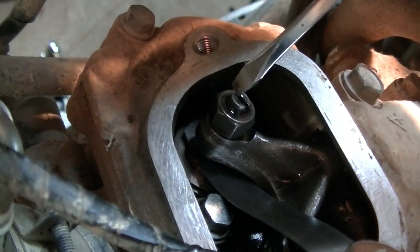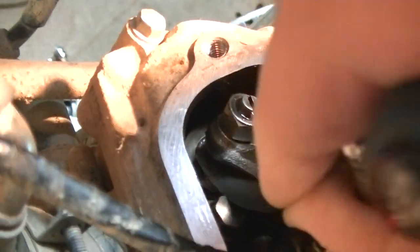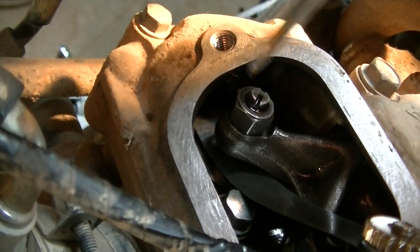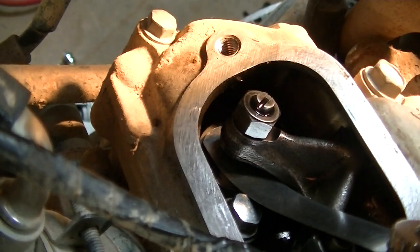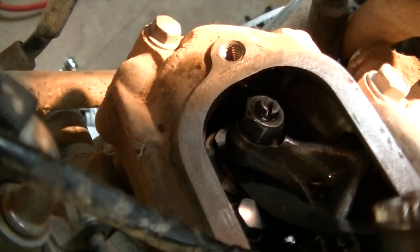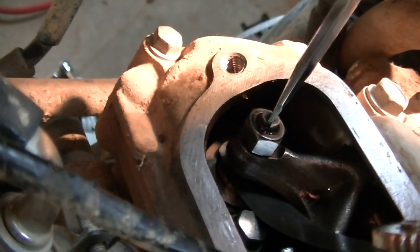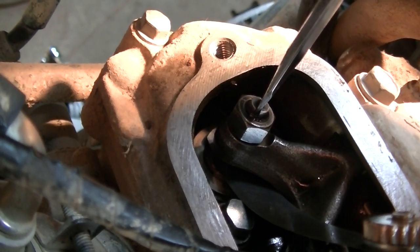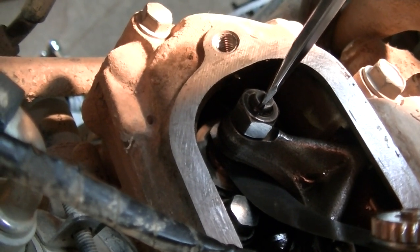That's good, but I think I can get a little bit better. So I'm going to turn a little bit more. These are very sensitive, so you can go from real good to way overboard. Just that little turn and it's too tight. Now we're going to back it off just a hair. I'm looking for snug but not loose. So now I'm going to put my screwdriver right on that and hold this, and use that 10 millimeter wrench to tighten that nut while I'm keeping this screwdriver here so I can hold that position. And I'll leave my feeler gauge in there, and when I pull that feeler gauge out after everything's tightened, I'll know immediately if anything moved.